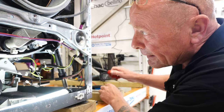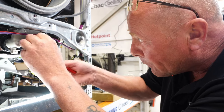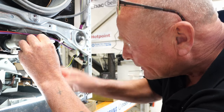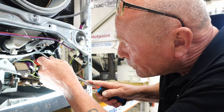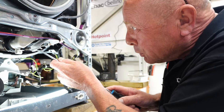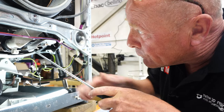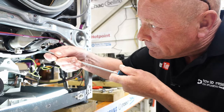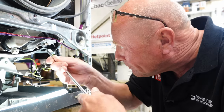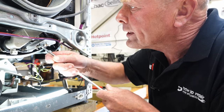The NTC sensor is not damaged, but I believe the heating element is damaged because the bearings collapsed on this machine. I'm just pulling the element back so I can get underneath the seal. I might need to use a different tool — I've got a hook here which will just take the seal down. Then I can pull the seal towards me, and I might need to do that in a few places to release the pressure off the seal from the drum. Now I've got it through, I can go round and lift all the sides. They are quite tricky because they're a push fit.